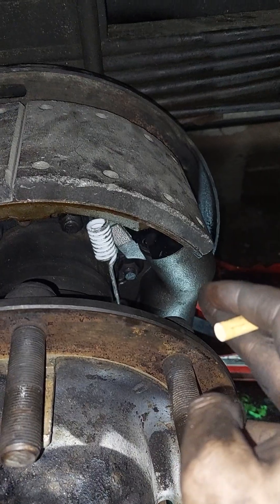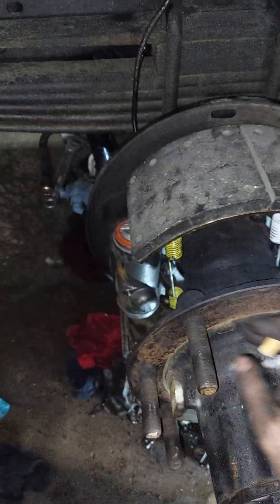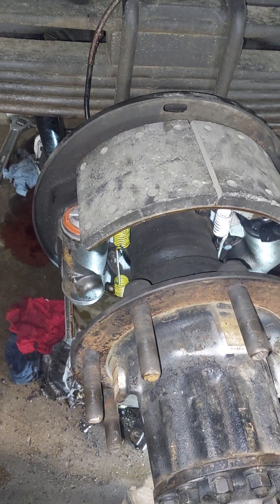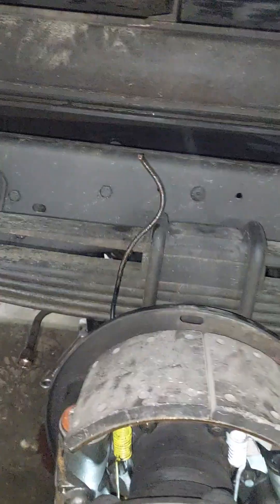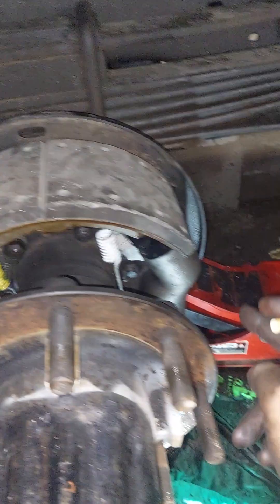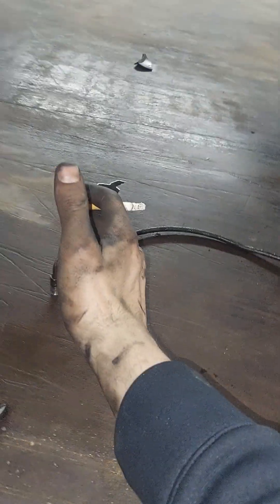Your front brakes — like I said, your front wheel cylinder is the service cylinder. Your rear cylinder is a park brake assembly and service cylinder combined. What you've got is your main line, it's a 5/16ths hydraulic line, it goes into your front cylinder. Then you have a line that loops around from your service cylinder to your park brake and service cylinder — it's kind of both.